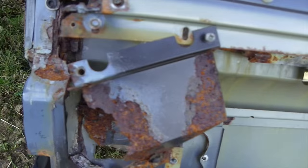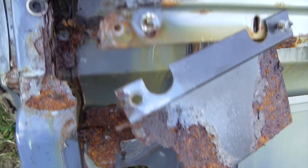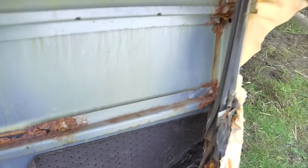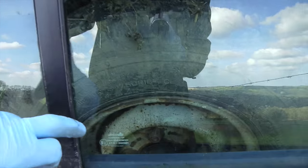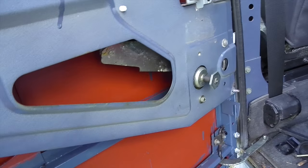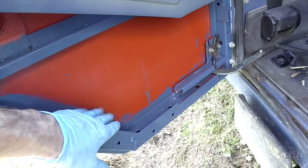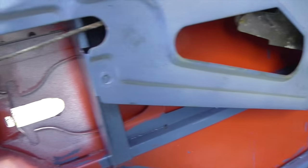Just to re-go over what we've done: we've replaced this door due to excessive corrosion down in the door. It's a door that's 20 years old and it hasn't done too badly. I've ordered new runners and fillets to go in here because obviously these are so bad. I've given the new door loads and loads of coats of paint, and I've also red-oxidized the aluminium so it will soak down into the join and hopefully won't react to the steel with time.